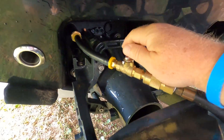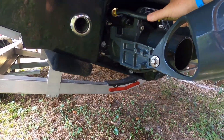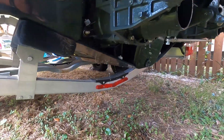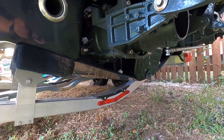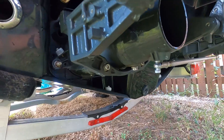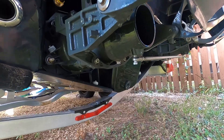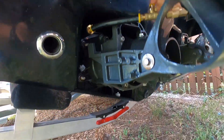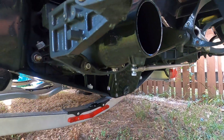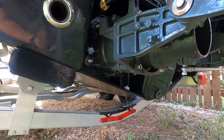Once it's hooked up like this, there's nothing to it but turning on this valve. Let me back up and you'll see the water come out the bottom. There it is — see it blowing out? Give it a few seconds, then turn it off. You've still got water dripping out at the bottom, and a lot of it blew out the back. Hit it several times with pressure. If you just leave it on, the water keeps coming out, but it seems to be that hit of pressure that gets it the best. Let me do it again — more coming out the back and at the bottom. Go four or five seconds each time.